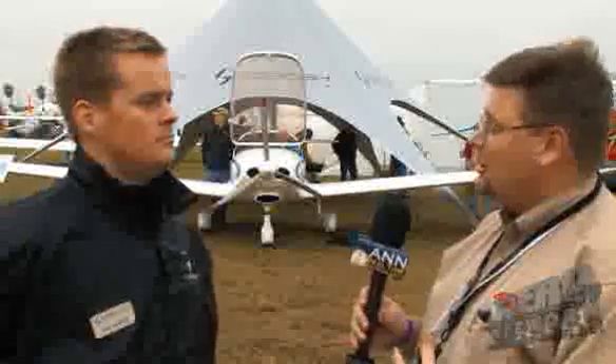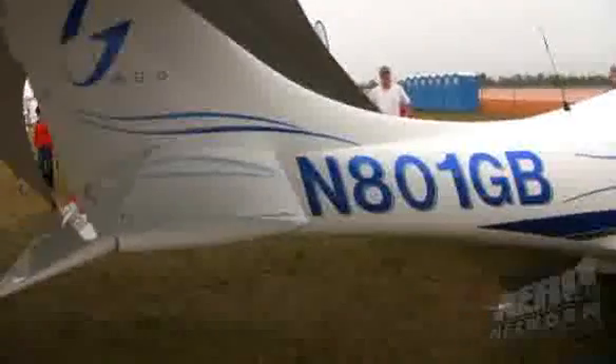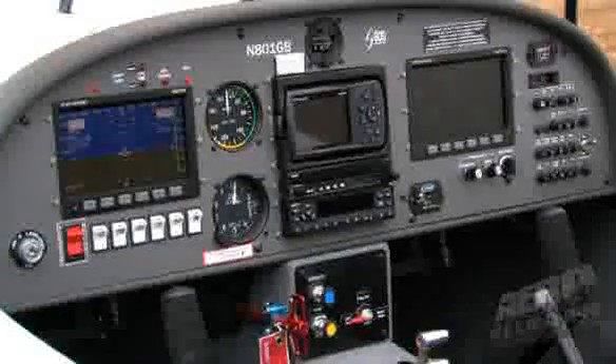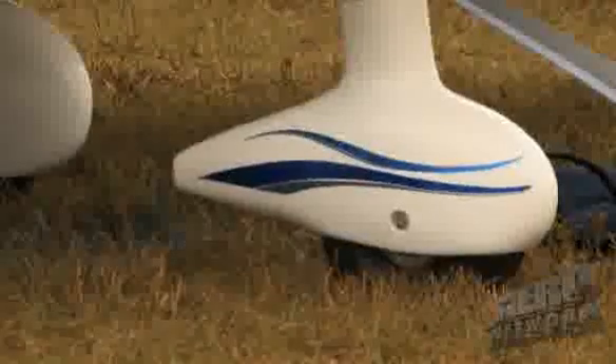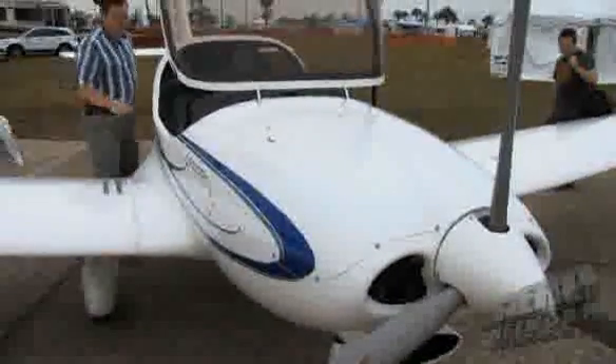You're making some advancements still in the design before the airplane is officially put on sale. Well, this airplane is for sale, but we are making some changes. This is our first production airplane — serial number one of the light sport 800. We're going to change the seat position a little bit, change the panel and the way it looks, make some refinements on the labeling on the panel. We're changing the wheels to a standard 500 by 5 and putting Matco brakes on the airplane, and exploring everything to make sure it's easy to maintain and a good airplane for a customer to own.